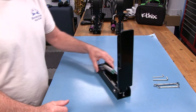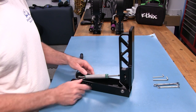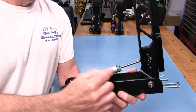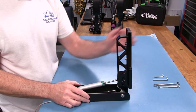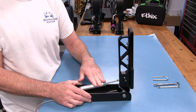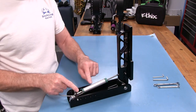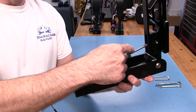Now let's look at throttle pedal adjustments. The main concern is the linear position sensor — it has a limited internal travel, and there's a stop internally. If you push the pedal to its physical stop while the sensor rod is fully extended, you can damage the sensor. So there's really no way to tell where that stop is without removing the sensor and measuring. If you move the pedal further forward, you need to move the pin attachment point up one hole to avoid bottoming out the sensor.